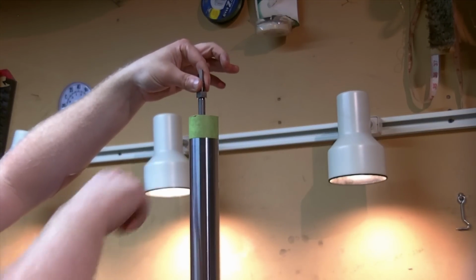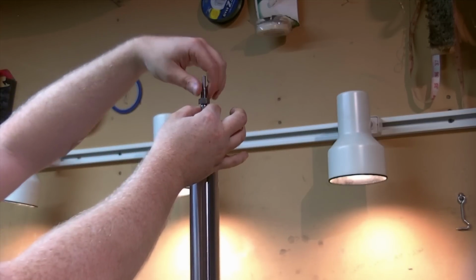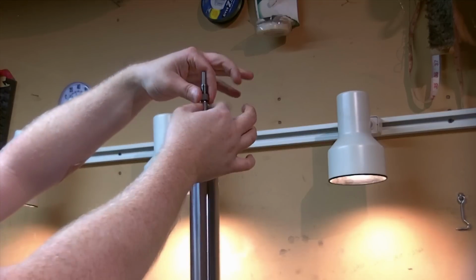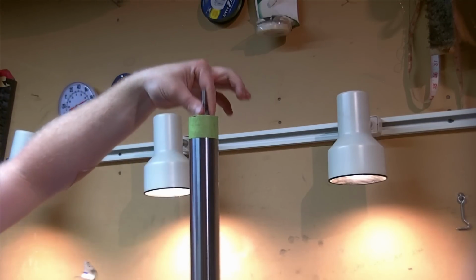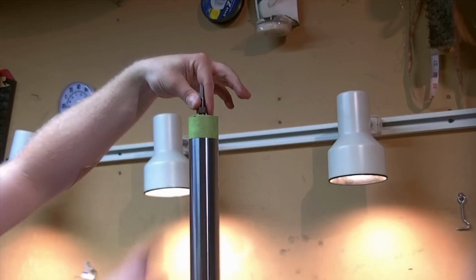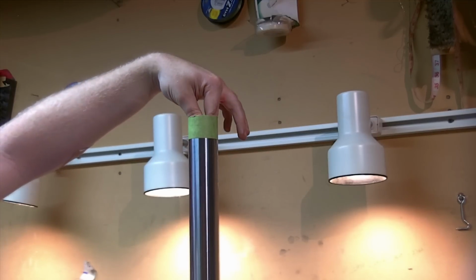So a good trick, if you don't have the special tool which threads onto the end here, or you make one so you have a rod to hold with, is you get a piece of wire. You wrap a piece of wire here below the jam nut or on the threads, and that just allows you to fish this out as this falls down over and over again. Just stroke that. I'm going to get my wire set up here, and we'll come back and do our initial fill and bleed cycle.